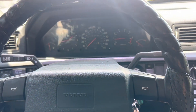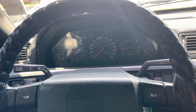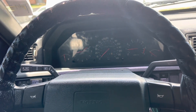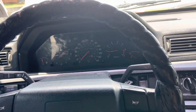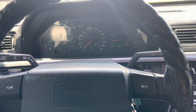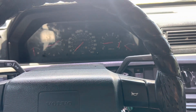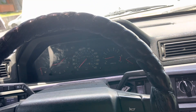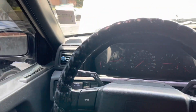I changed the spark plugs and spark plug wires. The only thing I never touched was the distributor cap and the rotor. And I looked at it yesterday and I noticed that it's worn, and it definitely needs a replacement. Right now it's fine. Those are my little problems, but I thought I'd fix this. Even though it is pricey, I think long-term investment, it's a good purchase.